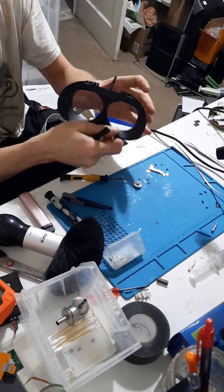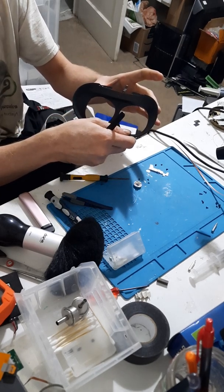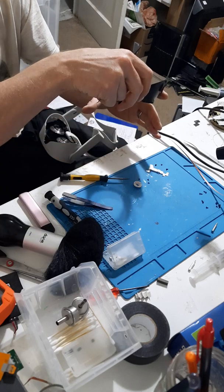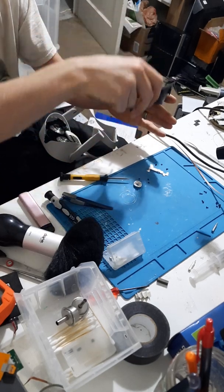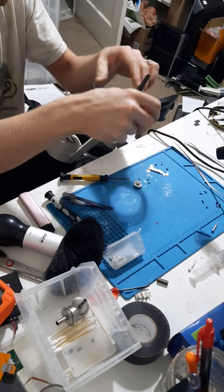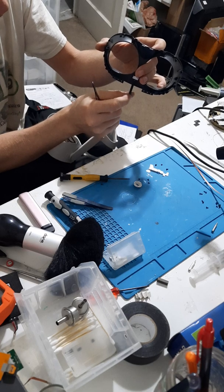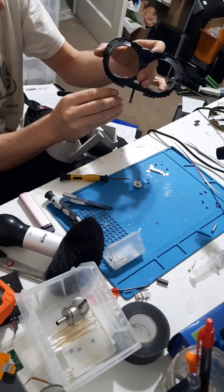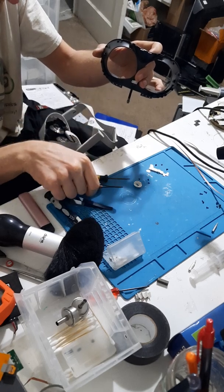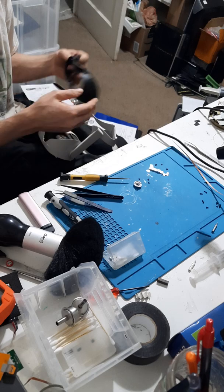You want to be careful because there is a ribbon cable. When you pull that out, same as before, you want to go up and over — kind of like you're folding a page on a book. Because you'll need to disconnect this cable, and even after you disconnect it, it's actually held in place with some adhesive. You've got to break that adhesive loose to get it to actually come unplugged, and then that piece will come out.